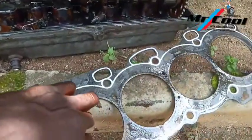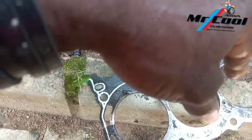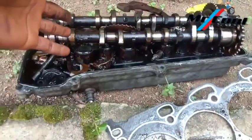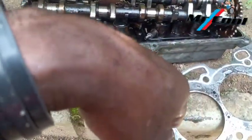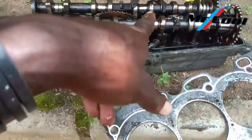If you look at it from the back you'll see it looks very black. When it loses compression in those areas you might misdiagnose it if you don't have vast experience with overheating issues — you could think you have some other problem related to the car not starting. But one telltale symptom is when you start up the engine with the coolant cap open, you'll see what comes out. Meanwhile, the customer said that while driving they were perceiving smoke — but actually it's steam coming up due to the lack of coolant, which leaked out of the radiator.